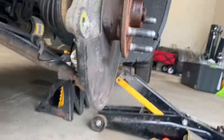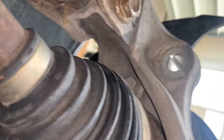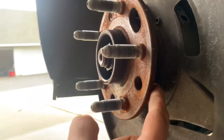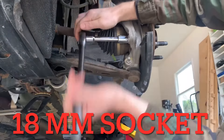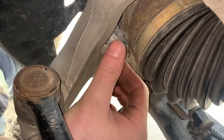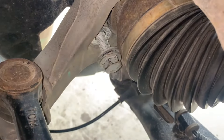Now it's time to remove the wheel bearing. There are three bolts that must be removed from the back. Use an 18mm socket to remove the bolt toward the front of the car — this is bolt one of three. Then remove the bolt towards the back of the car; although fully unthreaded, it was trapped by the CV axle — bolt two of three. And there is not enough room to access the top bolt — bolt three of three.